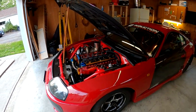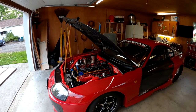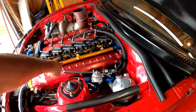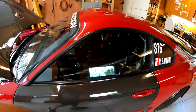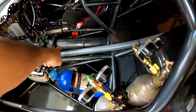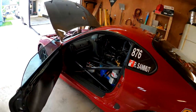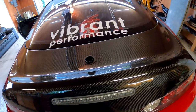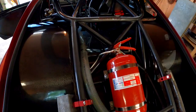Basically we tried to put a dry sump stage on the valve covers and that did not work — it was pressurizing too much crankcase pressure. So I went back to the setup that I had last year, which is these two ports on the side of the block going to a big fitting in the bottom. They all merge into this big hose here, which is a 1.5 inch ID, and then it goes to the catch can in the rear.